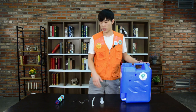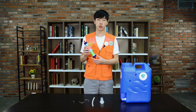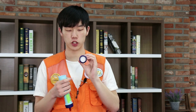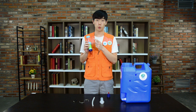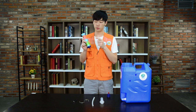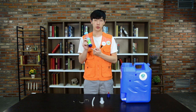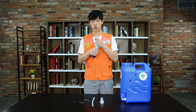Once we have that, we will get the filter and make sure everything is in the right place. First, remove the upper filter cap and make sure that there is a microfilter on the cap — this is very important. And once you have that, make sure that you have the carbon filter with the orange sticker, the ultrafilter with the green sticker, and lastly the bottom filter cap. Once you have all of those, screw it back in place.